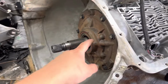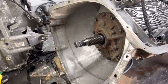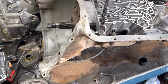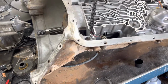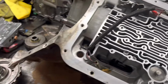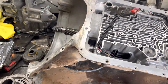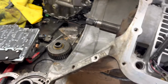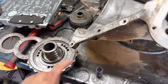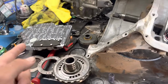Additionally, there is a line to lube hole that you can drill inside of the pump. You drill a hole and it bypasses a little bit of fluid through the pump to aid in, I think, more lubrication flow through the cooler, or to my knowledge, it just boosts the fluid flow to the cooler. So that's a good modification to do. It's for the converter. It relieves pressure so that instead of going into the converter, it goes through the cooler. I believe that's exactly what it does. So in any event, those are all the mods I did to this thing. There was the 1/8" hole here, the hole on the direct drum, the hole in the pump, and then one hole in the valve body.